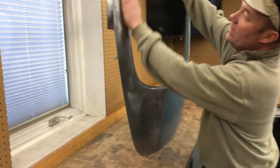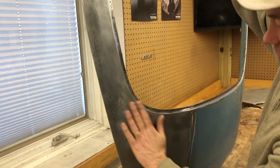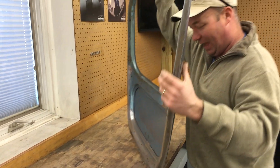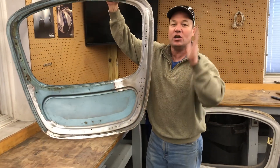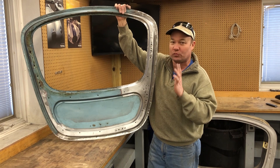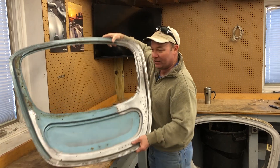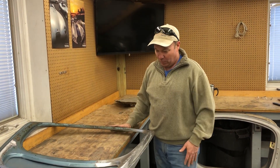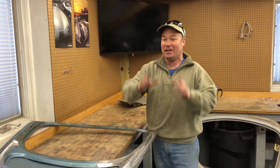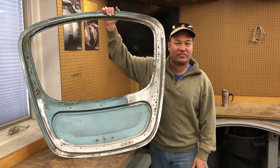In addition, over here there were some problems with the skin. I hammered and dollied that out — I didn't go crazy on that because it's going to need a little bit of filler on it anyway. And then I fitted it to a 61 shell that we have over there. So the moral of this story is: don't try this at home. I have got over 12 hours in this repair, and those were hardcore, getting right down to it hours. That is what I've been working on most of the weekend. Here is the hatch — it's done, and it is destined for Le Mans.